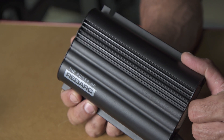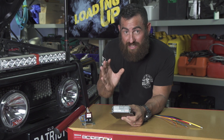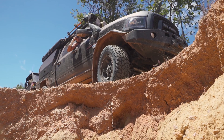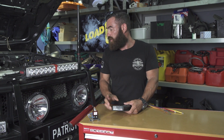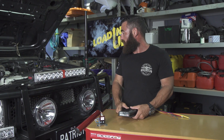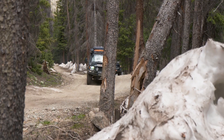The BCDC 1225D — the last three digits are the ones that matter. This is a 25 amp charger, so the 1225 is good for up to about a 200 amp hour auxiliary battery. If you're going to run a bigger auxiliary battery or batteries than that, you'd want to go for the 1240, which is a 40 amp charger. This one here is the D model, which means it's also got a solar input. The unit we have fitted to the black truck is the same one we put in when we built it three years ago — it doesn't have the lithium profile charging or the solar input. But I'm going to swap this one out to one of these, and I'll tell you the reason why.